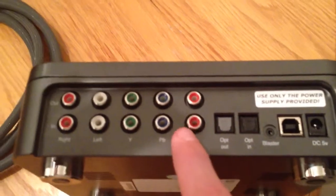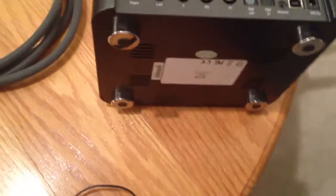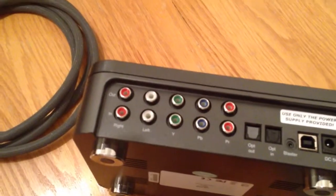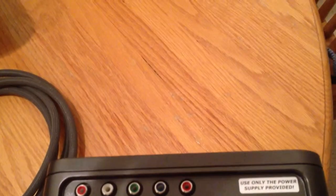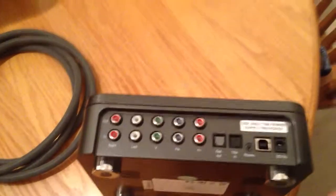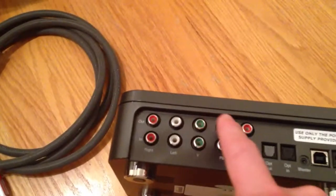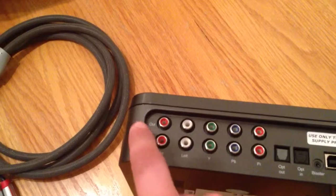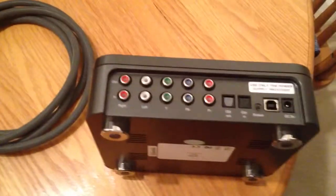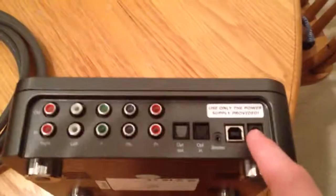You're going to have to plug them into these three ports right here. And then you need to get a double-ended HD RCA cable. But yeah, that's all you need for that. Then you plug it into the top three slots where it says 'out,' and then you plug that into your TV — that'll put the video through your Hauppauge into your TV. And then when you plug this cord in here, it'll go to your computer too. So that's how that works.